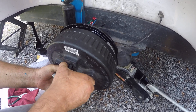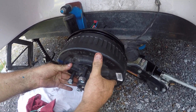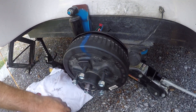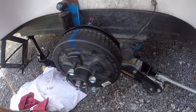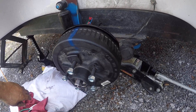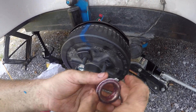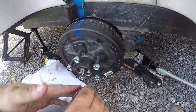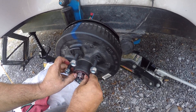I'm going to set the hub in place here. The brakes are a little tight so I'm going to have to adjust it. Okay, that's inserted. Now, remember we're going to reverse the sequence. You probably got a new bearing set that's already pre-greased — if not, you're going to have to grease it and then insert it.